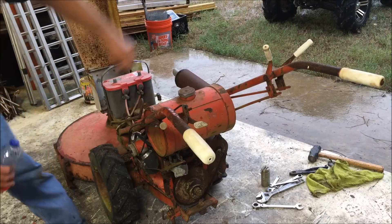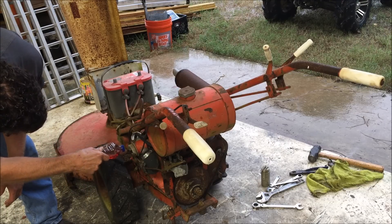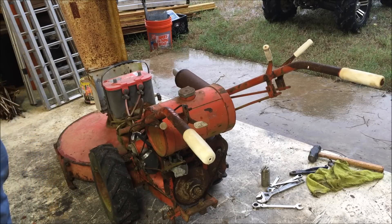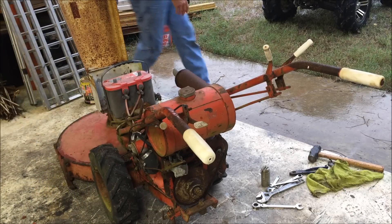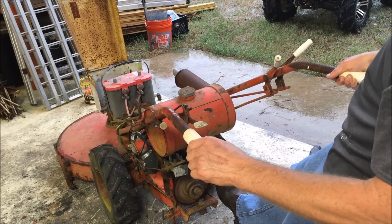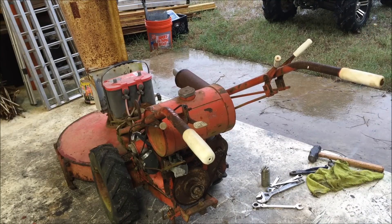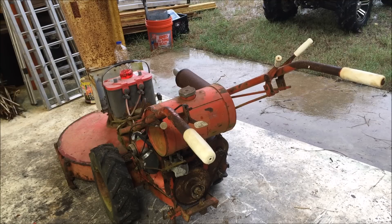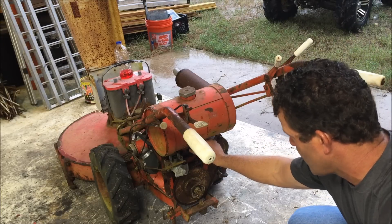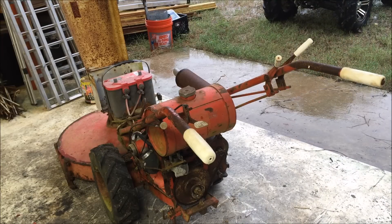All your levers are in neutral. Put my fuel in there. Let's see if we can just get it to fire. Alright, nothing yet. So now I'm going to check for some spark. I just shot a little fuel down inside the cylinder. I put some fuel in the tank. The tank valve is open. I'm not giving up on this thing just yet.